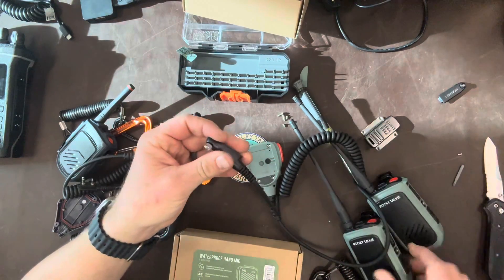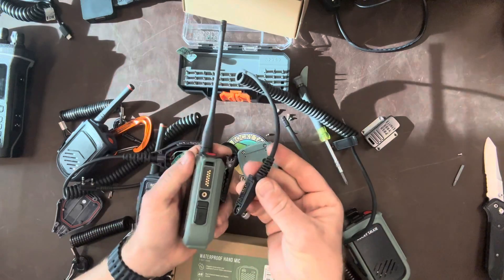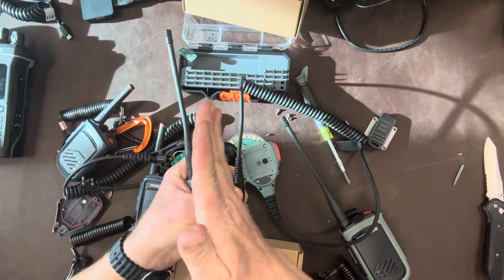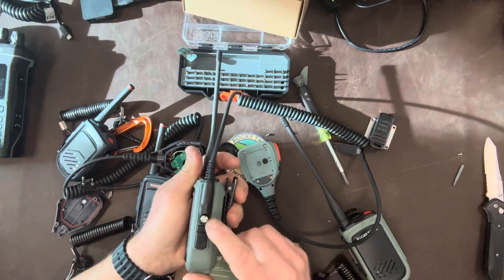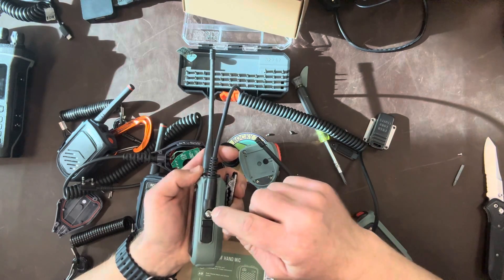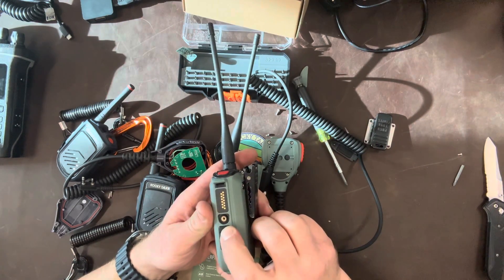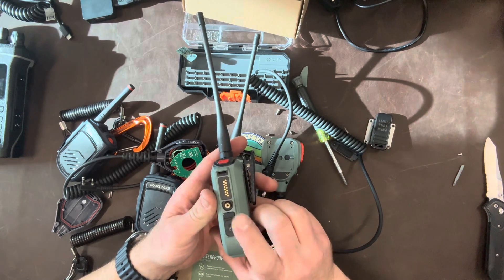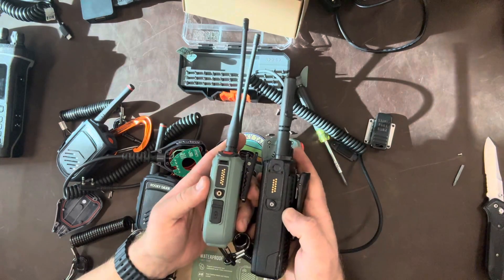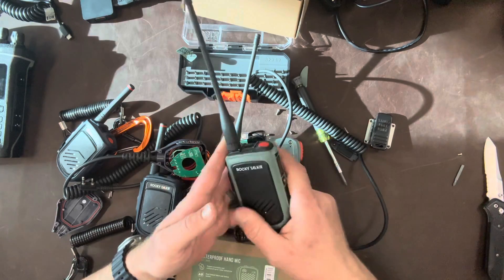When you put this on your radio, first you are going to remove this little cap off the side, and then put this angled latch in the top, push it in and up, and then put the screw down. Now there is a flathead slot in this, but I strongly encourage you to not use that to tighten it, but use it to remove it. The reason for that is there is a brass embedded boss inside this plastic, and if you tighten it down too tight, that could pop out. That is not a Rocky Talkie failure point - that is standard on Motorola as well. All radios are not designed to be cranked on with a screwdriver, so don't do that.